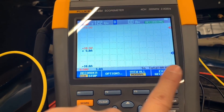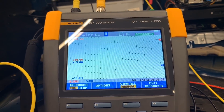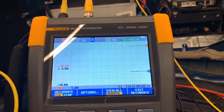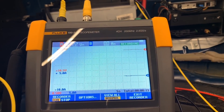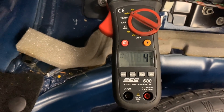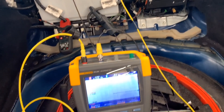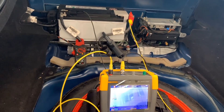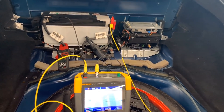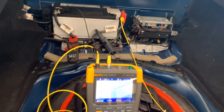I'll go back to the recorder — this is what I usually do. I click and enter and it plots the inputs to see if there are any drops. I also have a milliamp clamp connected to the battery negative, and right now I'm only seeing two to three milliamps, which is not a problem. I'm waiting for a spike. This car took almost an hour for all the modules to go to sleep — I was seeing about six amps for the first ten minutes, then it dropped to around 400 milliamps, then to almost nothing.